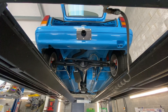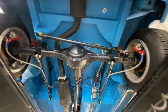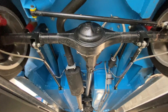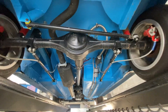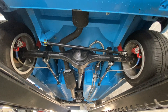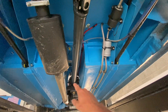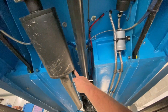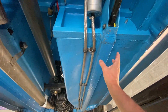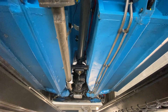Getting underneath, a full floor has been fabricated from front to rear. The Escort back axle uses a 5-link setup with Escort Mark II boxes — one, two, three, four, five links — very common on rally Escort Mark IIs and a tried and tested way of building these things. There's box section across where the back seats would be, and when he cut all the floor out he kept a piece in to keep the floors apart, then chopped it out when finished. He bought two chassis sections, put them in, and made the flat floor.